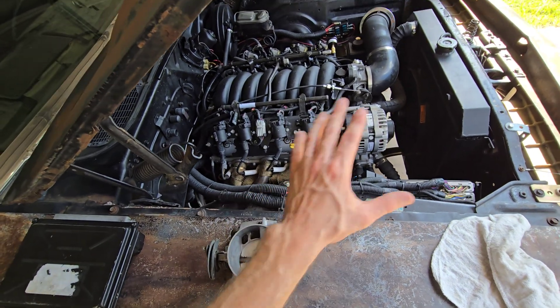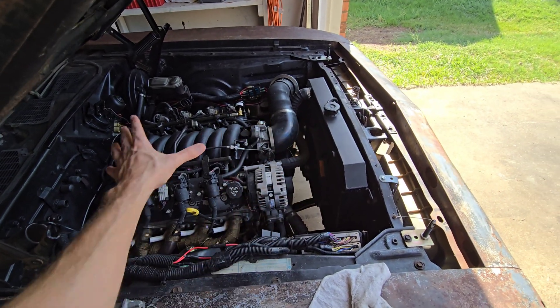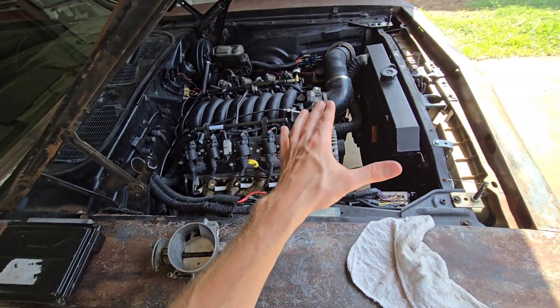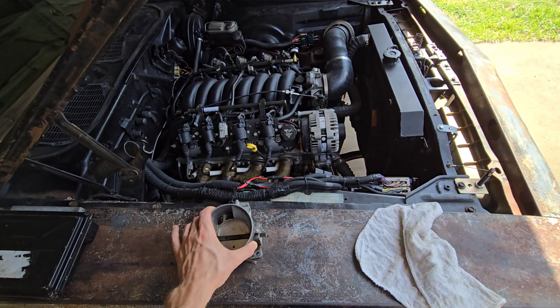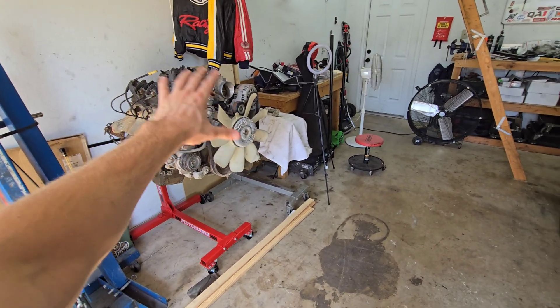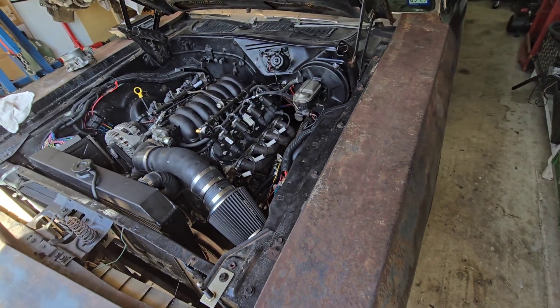You'll need to go through my other videos for specifics on harness differences too, but the point of this video was to give you a better path when deciding what setup to go with. Most of you will have drive-by-wire because that's what comes with the engine you get. Before you start buying ECUs and harnesses, hopefully you see this and decide to go find a three-bolt throttle body at the junkyard, grab a drive-by-cable harness and computer, and go from there.